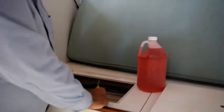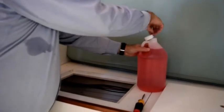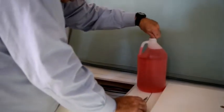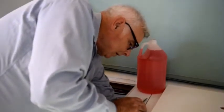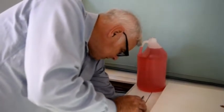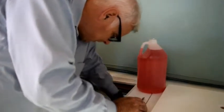The system is dry, so I'm ready to actually do the winterization. So this is a pretty simple procedure. I'm going to open a jug of antifreeze. I think I can probably do this with one jug. I'm going to disconnect the inlet hose to the pump and put another hose on there, like that. And this hose is here just for winterization purposes.